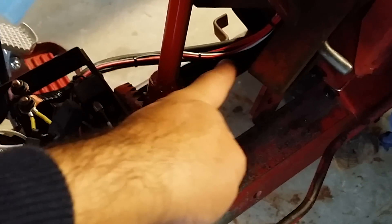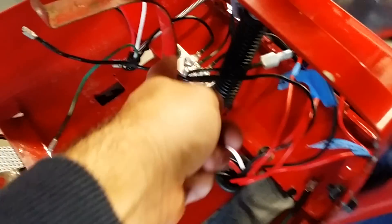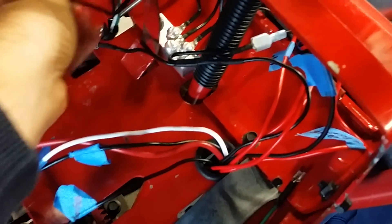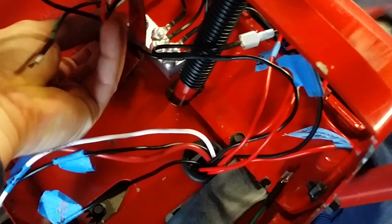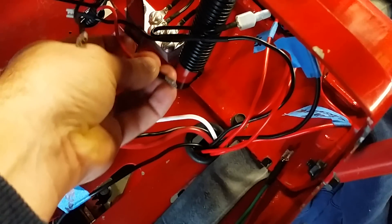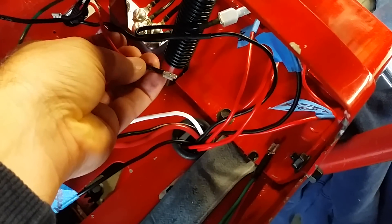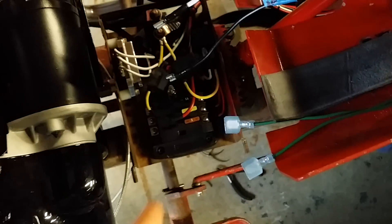I took all the sheath off the wiring harness. I'm gonna add that wire into the harness up and through, and it'll connect to the red wire right there. According to the directions I saw online, the tach takes a one-amp fuse, so I'll have to go to the parts store and get a one-amp fuse for the fuse panel.